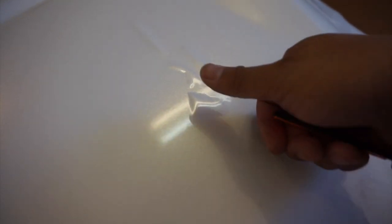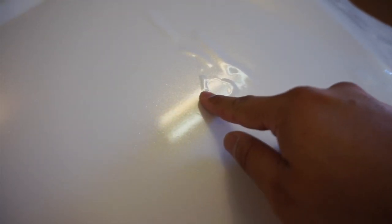Right now I've been going up and down just trying to work out the smaller pieces of air. This is air-release film. The way the film is manufactured gives it the ability to release pockets of trapped air. So in this case where I have a big run of bubbles, all I've got to do is continue to squeegee it forward, and with the amount of pressure I'm applying it actually allows the air to come out little by little. As the air is escaping, it's creating a secure bond with the car. I've done most of the trunk — I just haven't done the very tail end over here.